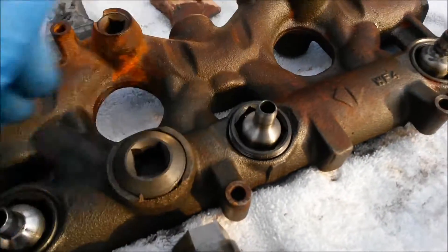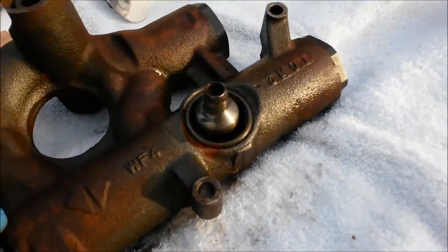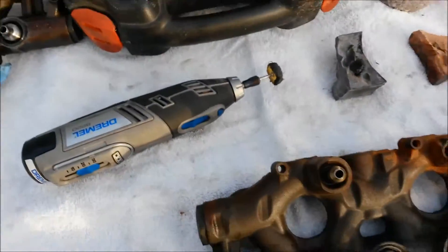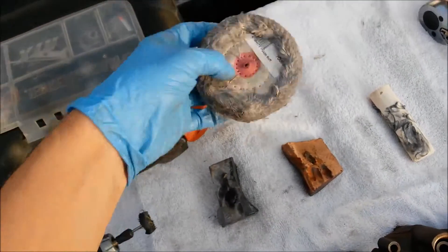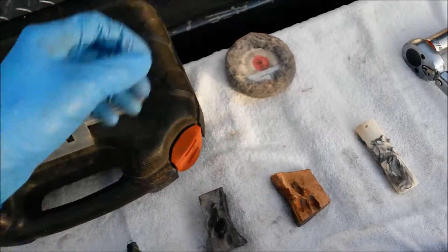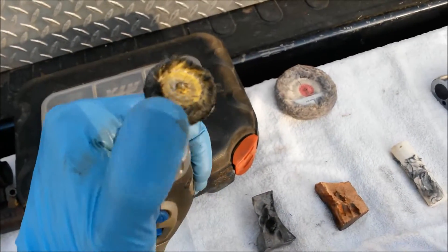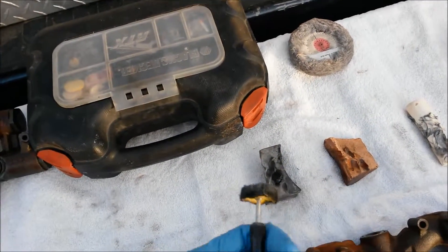I like to clean the nipple part itself while the nipples are still in place. So we'll go ahead and pick this bad one here. What you're going to need is a Dremel tool. You could also do it with a bench grinder with spin mandrels — you just spin these onto a little mandrel on the end of the bench grinder. But the Dremel tool actually works really well for this. You're going to need a polishing pad and a screw arbor to hold it.